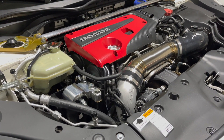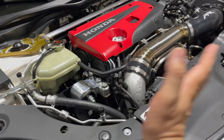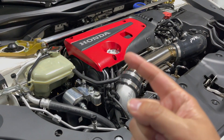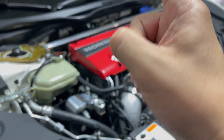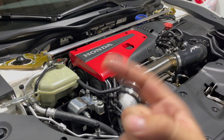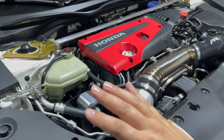I took it to third and fourth gear, redlined as well — same deal, 100% responsiveness. Downshifted from fourth gear at 6,500 RPM down into third and did not feel the engine rock at all. Same thing going from third into second around a turn — no rocking motion whatsoever. You guys with stock Type Rs know this engine rocks on you a little bit, especially without the rear Hasport motor mount. If you don't plan on getting the full kit but want a better feel, at minimum put that rear motor mount in — you will thank me. Just like the rigid collars, it is a simple modification.